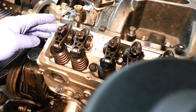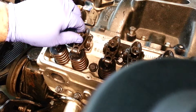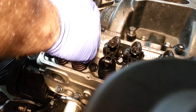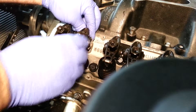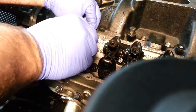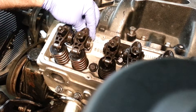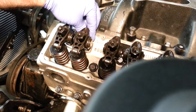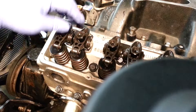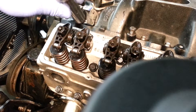Now that the exhaust is opening, I can set this intake. I'm going to take the nut that I already have here and put my polylock down. The pushrod is underneath the backside. I'm going to loosen it up — it's loose, I can wiggle this. I'm going to tighten this up until I've got a nice tight drag. What I'm doing here with the pushrod is I'm turning it. You can see my fingers moving — that's kind of how stiff I am. It's real stiff but it still will turn. That's where I like zero lash.